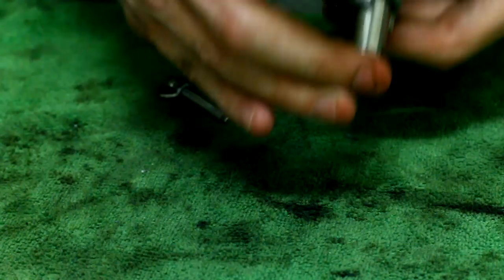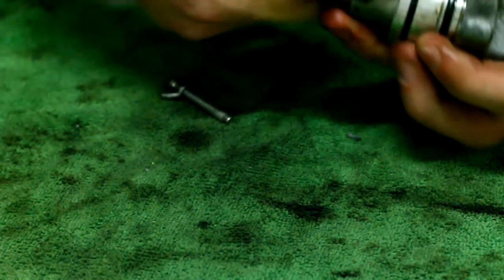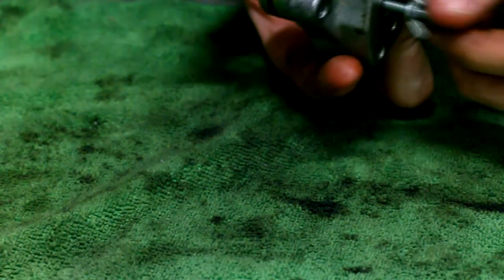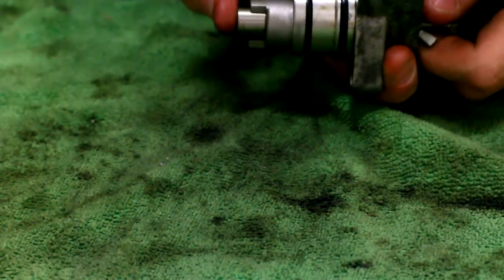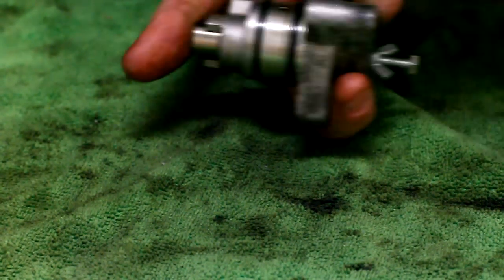Push it down and it should stop. Once you've got it pushed down, just keep turning it — it's kind of tricky. You keep turning it and it'll screw that worm drive in while inside. Get it down about halfway. Then take that plug you removed earlier — you can get this bolt down in there and it'll screw into the plunger. You'll see it's turning that plunger now. Take the wing nut, put it back against the plate, and you're just going to turn this while putting pressure like a needle. Turn this little nut — it's very easy to turn — and you'll actually see the plunger going down. Tighten the wing nut back up to hold it in place. It usually gets down to this flat edge, just about a sixteenth of an inch or so. You don't have to get it all the way down because it'll rest against the tensioner.